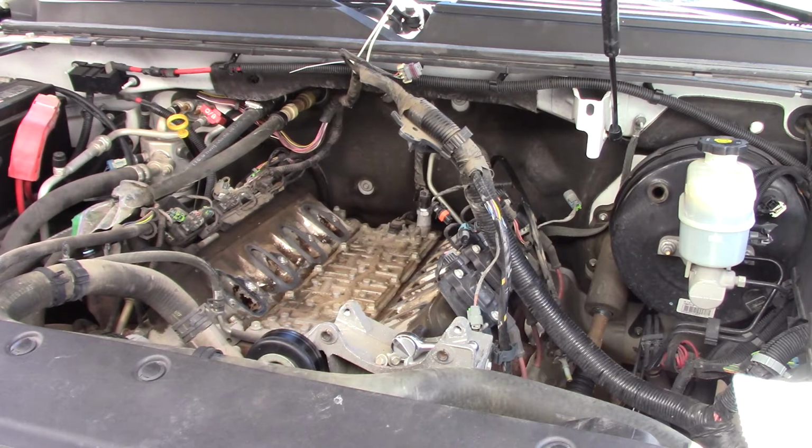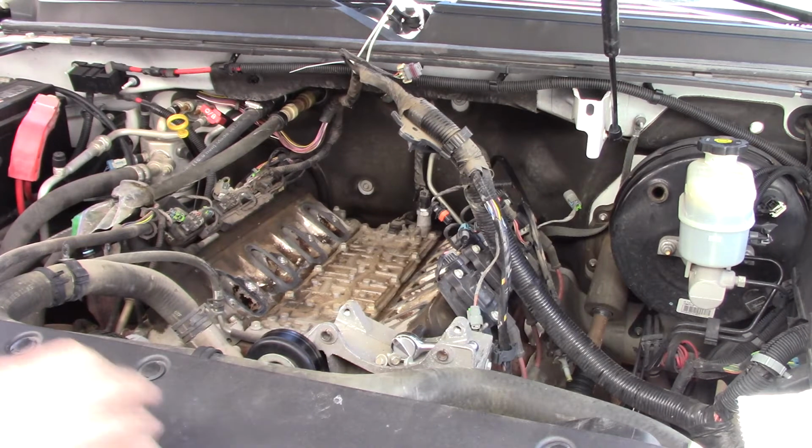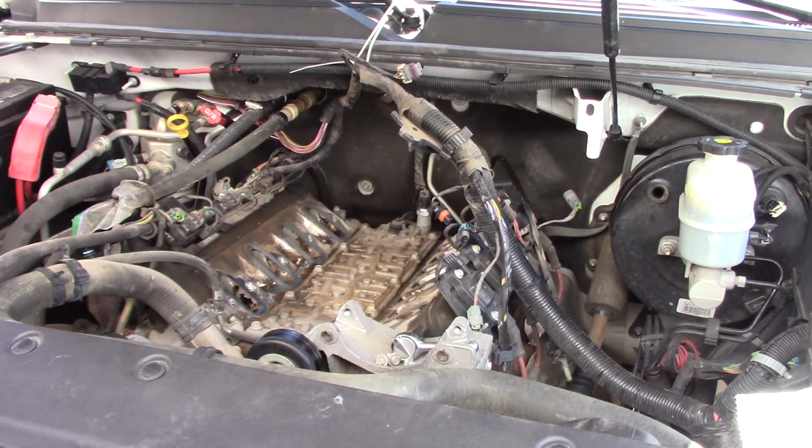But like I said, I use a lot of antifreeze. Maybe it was really low and they just filled it up, and it's just used to, you know, filling everything back up, got all the air out of the system. I'm going to keep an eye on it, but I have a bad feeling this thing's either got a bad head or it's got a gasket going bad. And these are 243 heads, so these are real common head. I might even have another set of these.